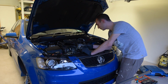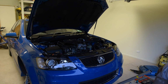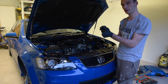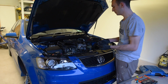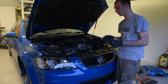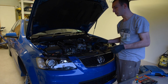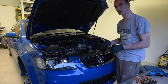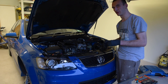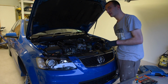So now I'll slide the D bushings on, which are floating around somewhere. Here they are. The D bushings go on just like you took them off. They open up like so, and you slide them over the sway bar. Then put the saddles on top and screw them down to probably 20-25 Newton meters, which is barely hand tight. All they're doing is holding the saddle down and not really dealing with much pressure. And like I said, be very, very careful when you tighten them down not to cross thread them, otherwise you risk snapping the stud out of the frame.